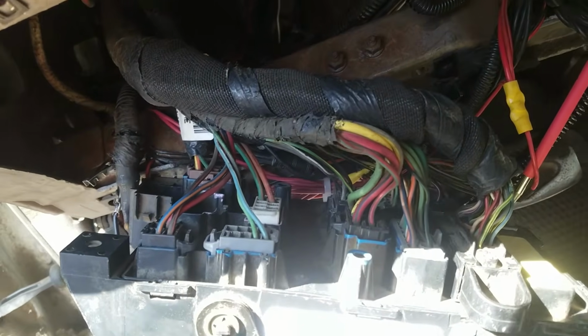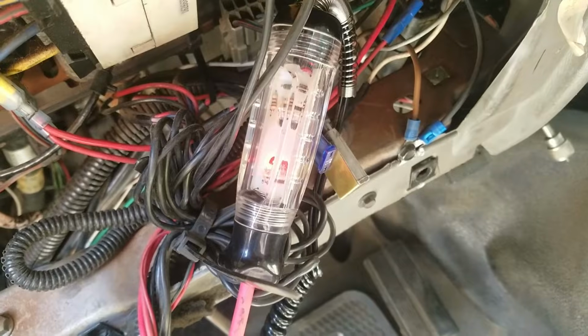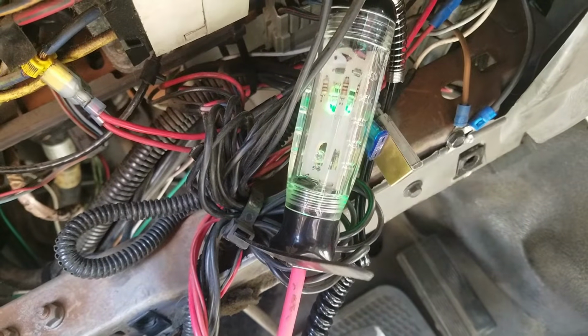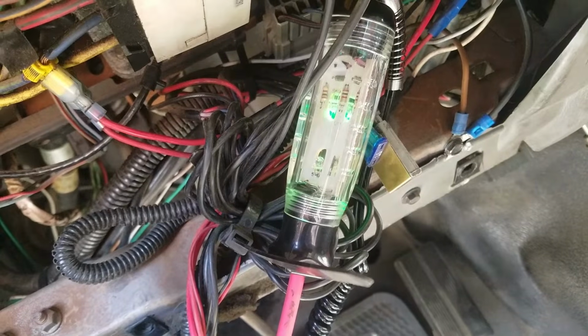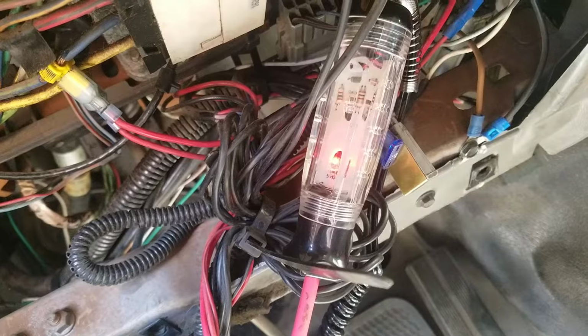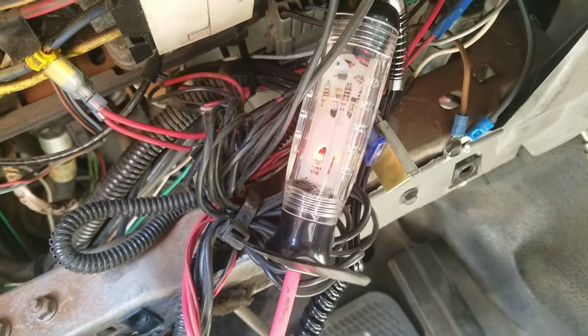I can use any one of the wires that are switched here. I'll find a suitable one for the positive, but the negative one for the relay that runs the coil in the relay needs to go to this wire so that the PCM kills the relay and kills the fuel pump after a couple seconds once you turn the key on. That's the safety feature I'm looking for.